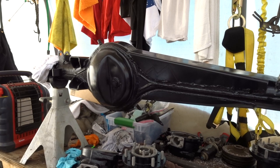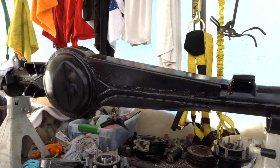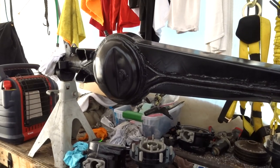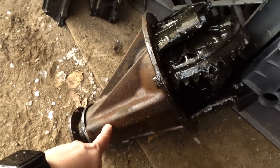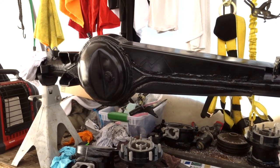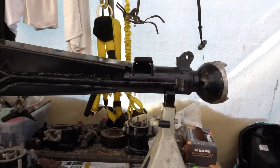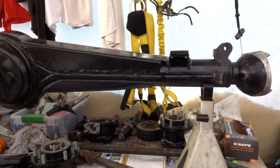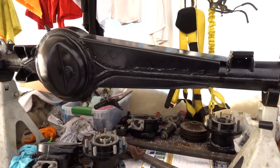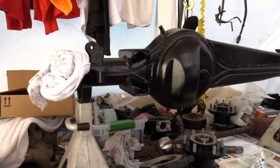The price I paid is super amazing because most of the time when you're buying these axles they're pretty much just stock, dirty, greasy, and nasty — still assembled, and you have to break them apart, clean them up, and paint them. For the price I paid, this is almost half done and prepped already. The differential that came with it is a regular 4:10 gearing, not a high pinion. If I do the solid axle swap I want a high pinion with 5:29 gearing and probably a Detroit or Grizzly automatic locker.